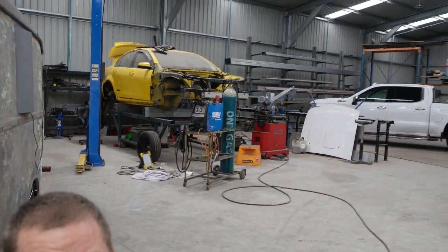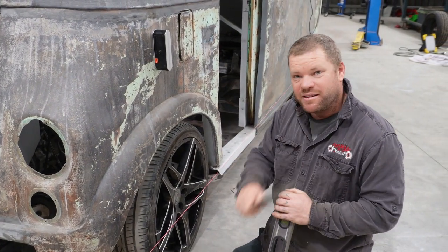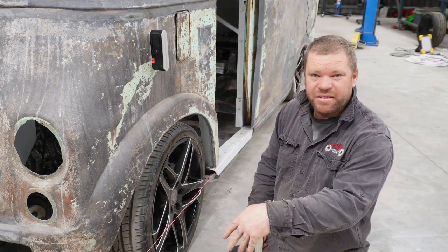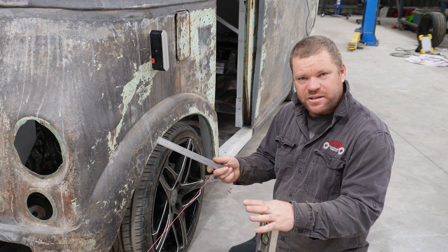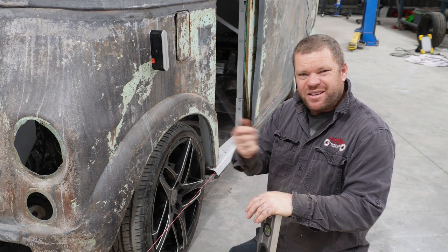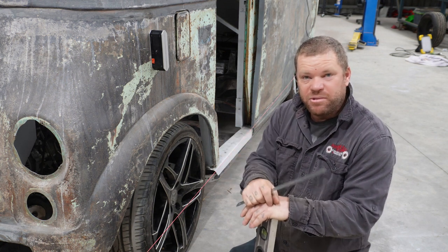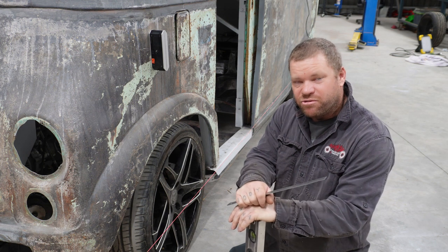So my values that I'm going for are based off the old Holden over there, because essentially the chassis under this is basically that car. So looking online, seems to be varied things. So for the toe, it says toe in, and it's a range really anywhere from 0.3 of a mil to 1.5 mil. And then the camber sort of goes from about 1/2 degree through to one guy done 2.5.